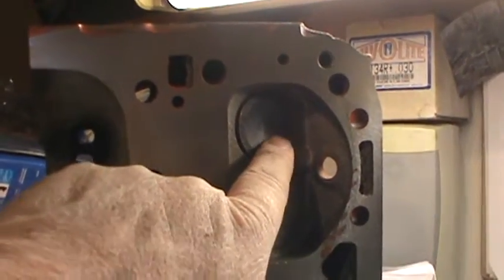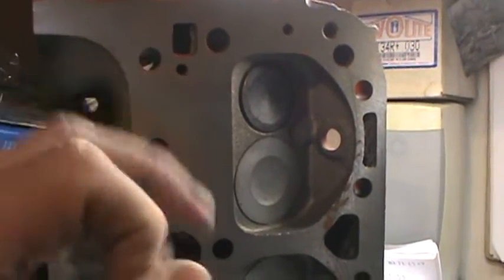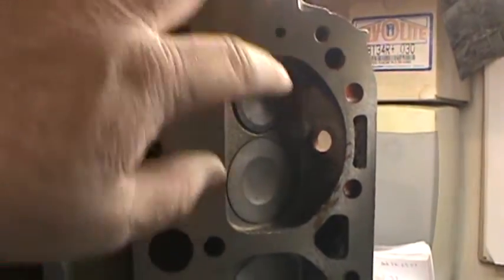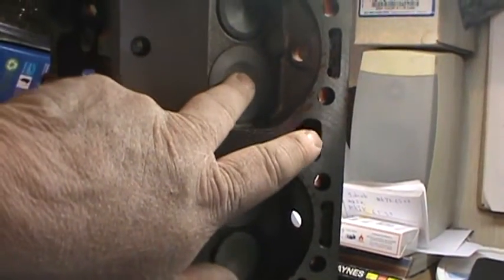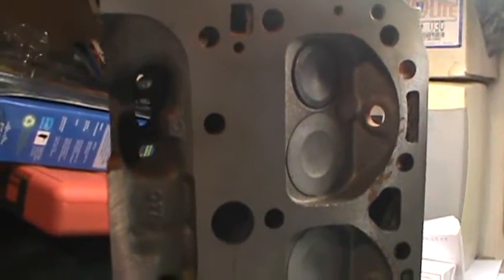We did change the exhaust valves, because the other exhaust valves were those big fat ones that were filled, and they like breaking the heads off and destroying motors. So yes, we changed them out. This set of heads got new guides and all different valves. I forgot about that. I knew there was something else, the reasoning. So that's why. I've got to measure those. Maybe we put 1.6s in it, but I don't think so. Yeah, I knew there was something I was forgetting on those heads.